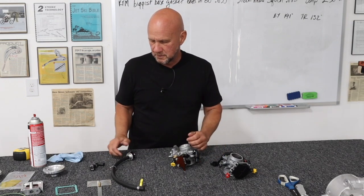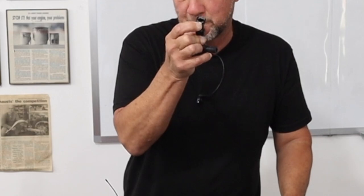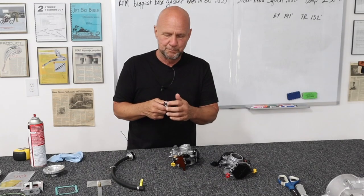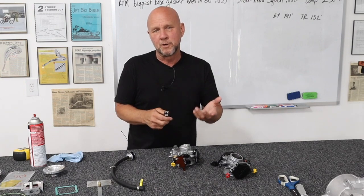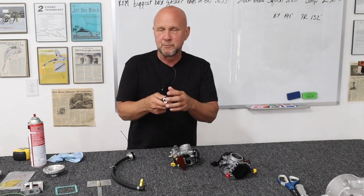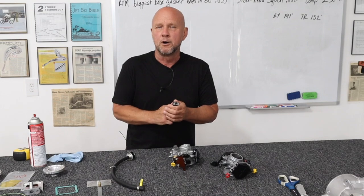The other thing that was actually making it run out of fuel is this quick disconnect part. It's got a plunger system in there. A lot of times people will put these things together and the plunger might cock. It would starve it for fuel. The bikes will run funny. You'd take it back apart, spray some good lube in there, push it together. The thing would plunge open all the way, open the passage all the way, and solve your problem. That's actually a relatively common problem when people are taking their tanks off all the time.